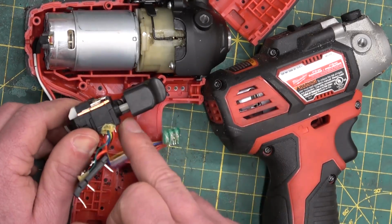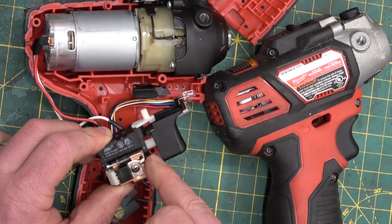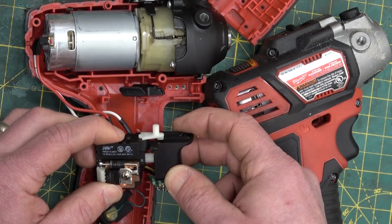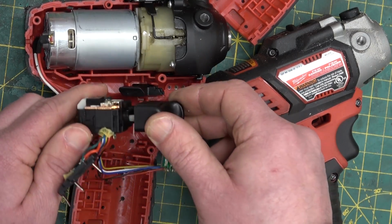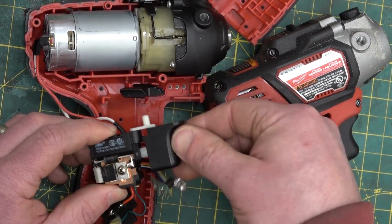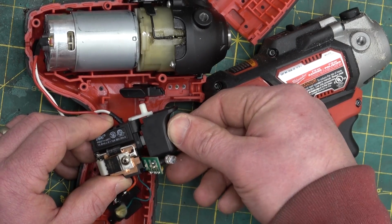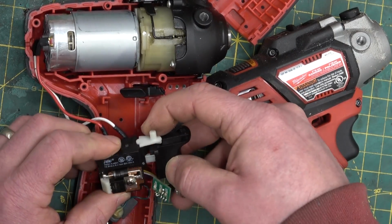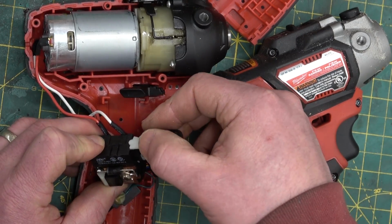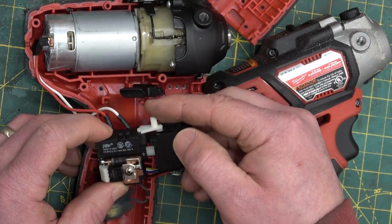No bellows on there. Now this is interesting. The actuator is on an ovoid rod, so it cannot twist. It's kind of interesting. I don't think we've seen one of those before. No positive snap action, just the barest whiff of trying. Very light detent on that spring mechanism in there. And it's also a one-size-fits-all switch because it's got forward and reverse. However, you do not need reverse.